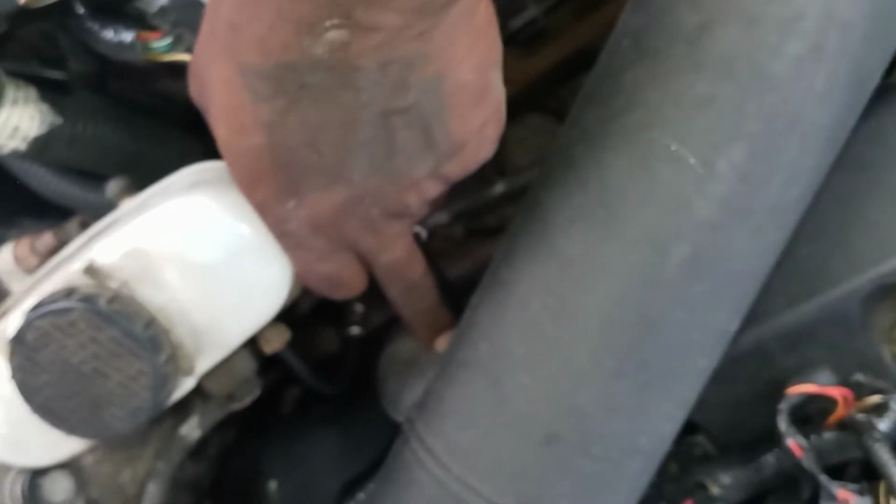Now, on the other engine, I did not have this specific setup right here with the tube, but I did have this. I used a stock tube with the stock breather hose on there. But as I keep stating, I used the same intake setup on a stock engine that when I would undo the battery cables and try to crank it, it would do the shaking, spitting extra condensation out the exhaust. It would do that on the prebuilt engine. Now, the only thing I could say is I'm going to have to just figure it out, but it's one of those gremlins that I thought was going to go away, but it didn't.